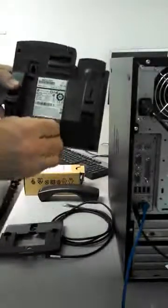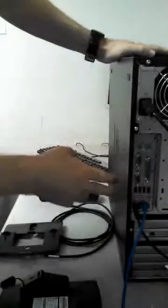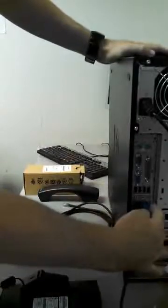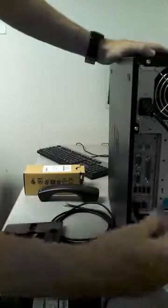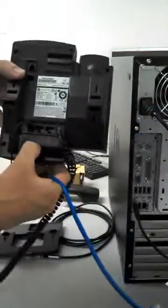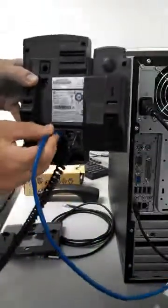Then we have the curly handset cord. That will plug into the rightmost jack on the telephone. Then you're going to need to locate the network cable on the back of your computer — standard HP at most branch offices. It's typically around the audio jacks and above the USB, typically blue or black. It has a tab on it so it doesn't come out automatically. Please push on that tab until it slides out. That cord will then go into the LAN port on the back of the phone — it says LAN, it has a network symbol on it. Make sure you put it in the right direction and push it in until it clicks into place.